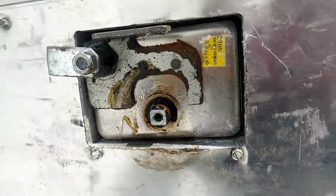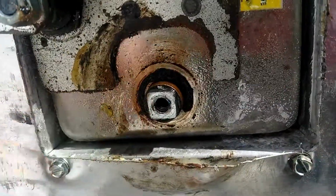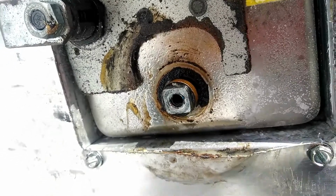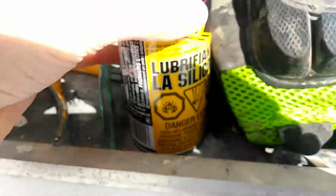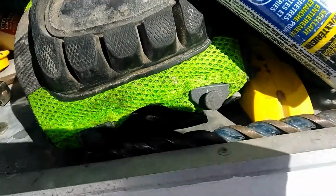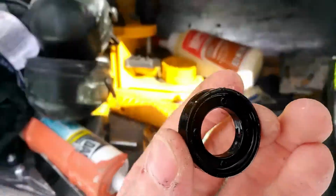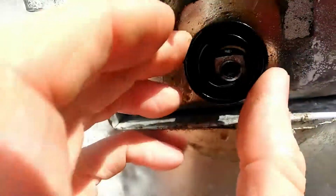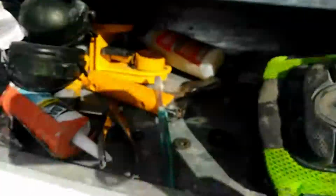Okay, so we figured out what went wrong. The cinch ring around that middle part that's all rusty caused a buildup of rust behind the plastic washer and pushed it off and loosened the whole assembly and let the handle start to spin. When I tried to gain access by drilling out the rivets, that allowed it to push out and loosen, and then the part that turns was getting stuck on the sheet metal along the bottom edge. See how it's all bent out along the bottom there? Well, I have to rivet that down so it stays nice and tight.